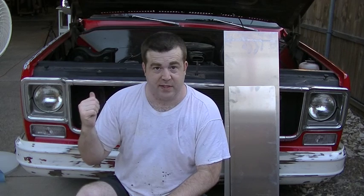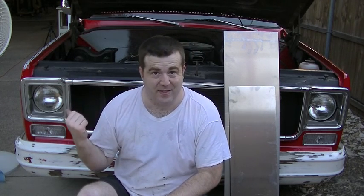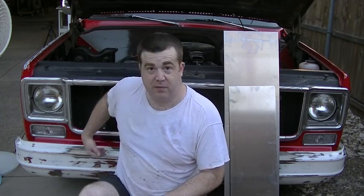When the truck gets up to operating temperature, the fan turns on and it holds it at that temperature, which is important to me. That's an idle test. If I was cruising down the road, I'm sure that temperature would drop as the engine RPM speeds up, the water pump speeds up, flowing that coolant through there, and not to mention the extra airflow going through the radiator.